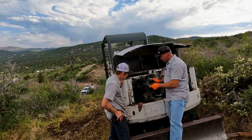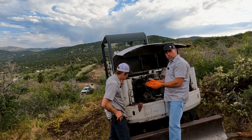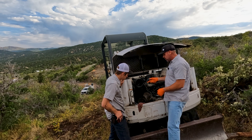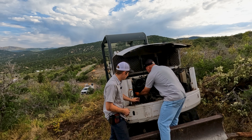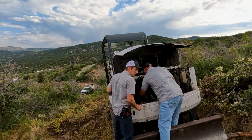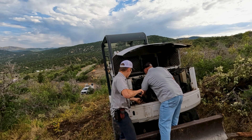Mike's already got the muffler out of the way and he's got the pump loosened up. We're going to back these bolts almost all the way out and then back the pump out of the coupler just to see if we can get some teeth engagement to get this thing off the hill. We're going to pull this pump off a good inch or so.